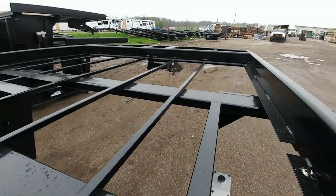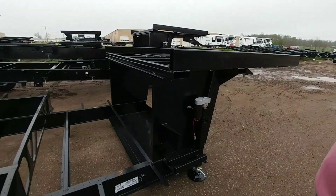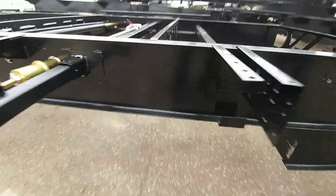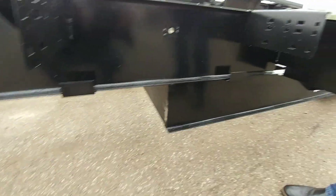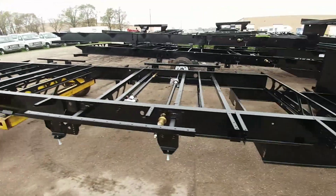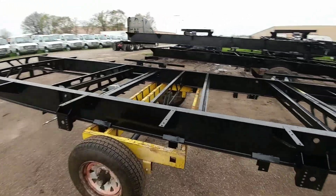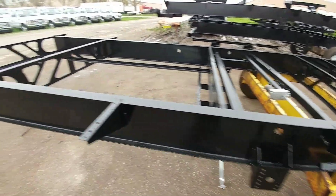You can see all the steel reinforcement and bracing that takes place in the overhang area here. This model already has its front landing gear in place. Working your way back, it's a 12-inch I-beam frame — that is a massive section — and it's attached to a 10-inch I-beam frame here. It's very rare for the industry to do that; some manufacturers go with a much smaller I-beam frame. The suspension hasn't been attached to this unit yet, but it does have the hangers for the auto leveling.